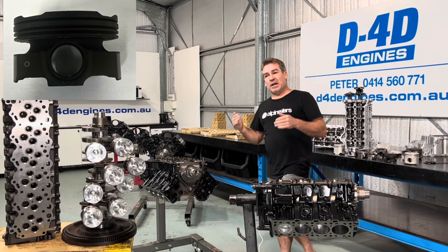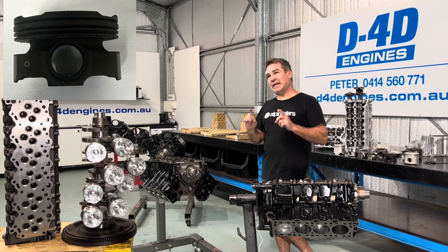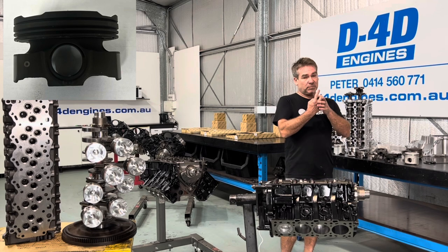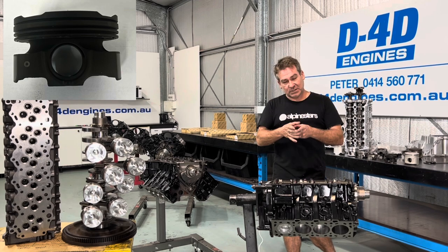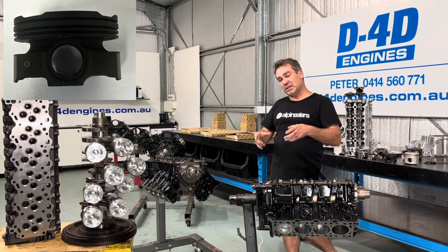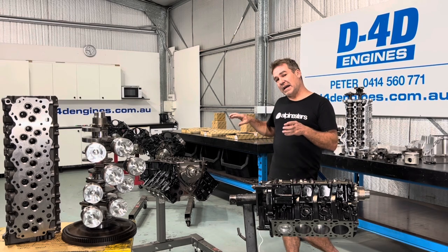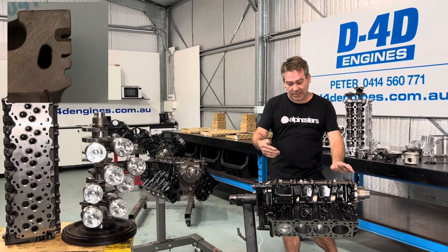So we've been able to drop away a massive amount of friction, yet still achieve the heat transfer that we want. Now that the rings have got thinner with less tension on them, the best way to achieve that heat transfer has been through oil being injected into the bottom of the piston. It gets squirted into the bottom of the piston, travels around the internals, drops out, goes back to the sump, and gets pumped back through the oil cooler. The oil cooler transfers the heat into the coolant and back to the radiator. So we're now relying on a lot more heat transfer through oil cooling of the piston than we ever had through the ring, because we've got a lot less surface area contact to the cylinder wall to transfer heat into the water jacket.